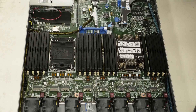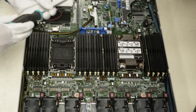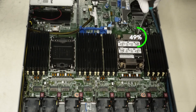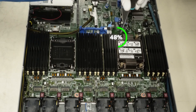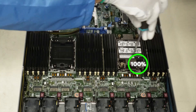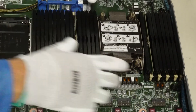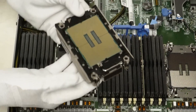As you can see, there are two CPUs on the motherboard — CPU one and CPU two. We're going to start by unscrewing the heat sinks with our T30 bit screwdriver. I'm using a manual screwdriver rather than an electric one. When banging out 100 to 200 servers in a day you're forced to use electric, but I'm a big fan of manual so you don't strip the screws and you get a good feel for when the heat sink comes off. Once unscrewed, push the two clips inward towards the center and lift up the heat sink to detach it and the CPU from the motherboard.